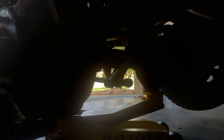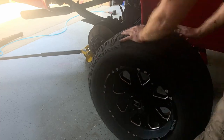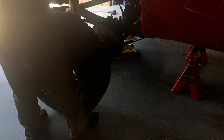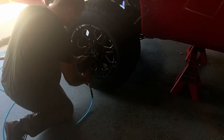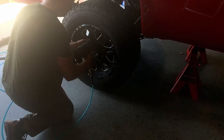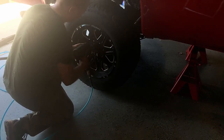Patience is a virtue here as many times this is going to take a little bit longer than video editing shows, and always follow your manufacturer's torque specs on your shocks. Once complete, you can go ahead and wheel your tire back out and get it remounted. When re-securing your tire, always torque your lug nuts down in a star pattern, then always make sure to take it around the block or down to the grocery store and double-check the torque — don't just do it once.